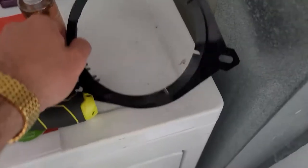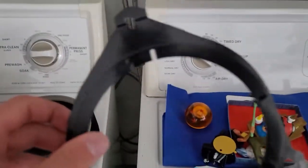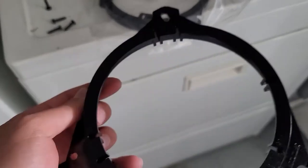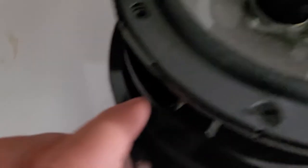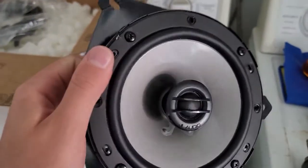First step — take your spacer. On these spacers we're gonna use these clips. There are two long clips sticking out, which I already broke off because I already fitted one side — I'm just showing you the other side. The part that's sticking out is where you're gonna place the speaker. Place it on just like so, and in the spacer you'll have these little grooves — match them up with the holes on the speaker. Once the holes are lined up, screw them in just like so.